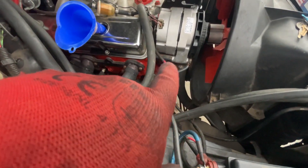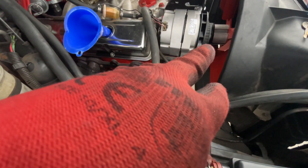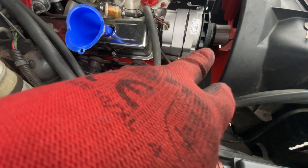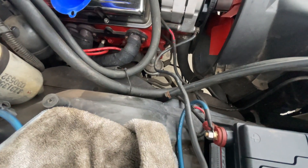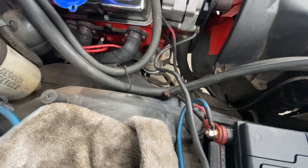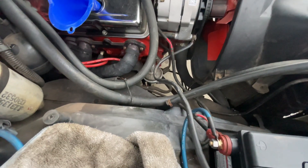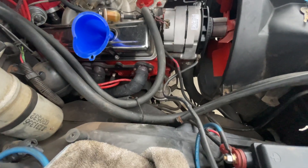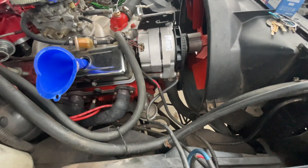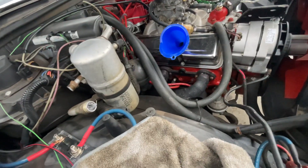My issue is when I have my music on, my blower motor on, my lights on, and the gauges on — my volts are like at 11, way below 12. When I cut the headlights off it goes up, when I cut the blower motor off it goes up to like 14-plus. That's telling me this alternator is not putting out enough charging amps to keep up with everything I'm running.